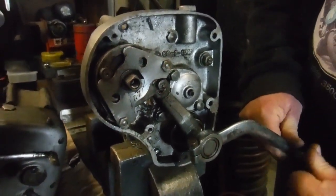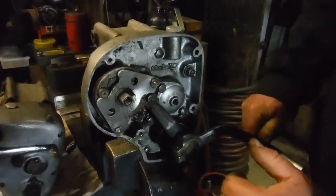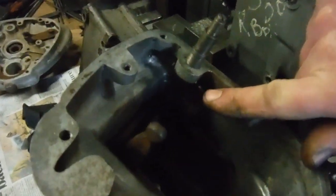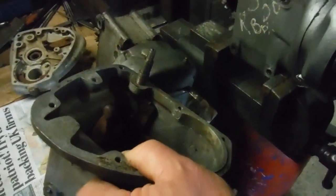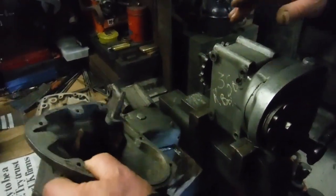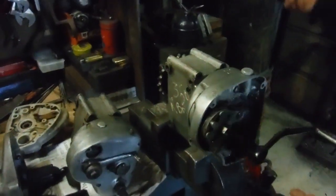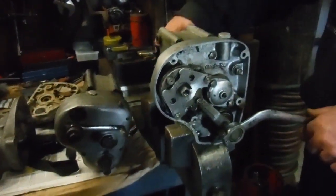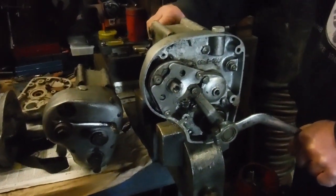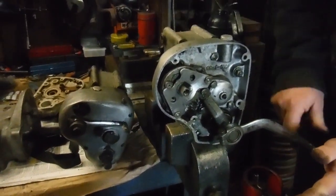You don't want any extra movement on that gear lever, because if you've got extra movement, what you're trying to do is move this a little bit further past its notch with the spring-loaded plunger, and that's when you can go past a gear, overshoot if you like, or if it doesn't go far enough you don't quite get it and you'll jump into neutral as well. So it's very important to have the clicks at the gear changes coinciding with the last bit of gear lever travel, like that. You've just got the click as a lever.